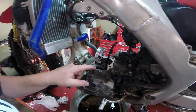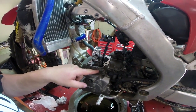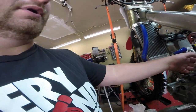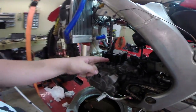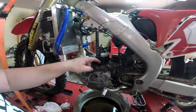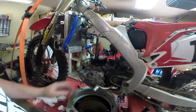Next step is our brand new jug gasket. It only goes one way — you can tell which side is up because this hole is off center. After this we can slip our jug on. The trick there is you want to pinch the top ring to help get it in there a little smoother, and we're also going to put a little bit of oil inside the jug to help the piston slip right in. Now we have the jug on, put the jug screw back in — you don't want to crank on this, it's very low torque. Basically that's just to keep the jug flattened in place.